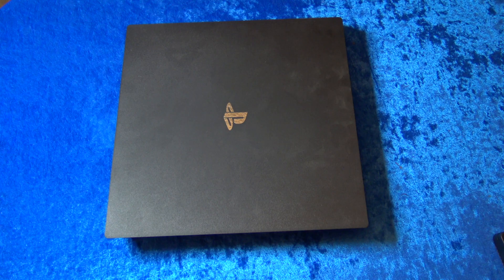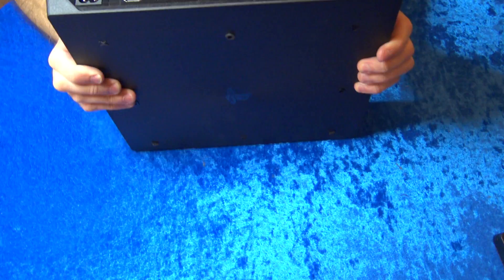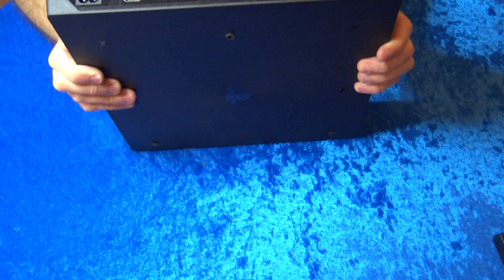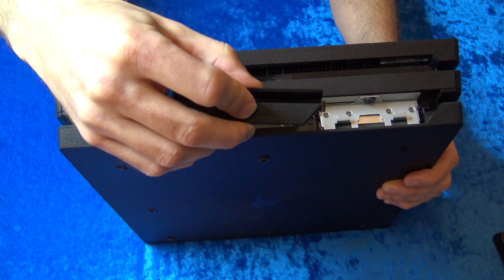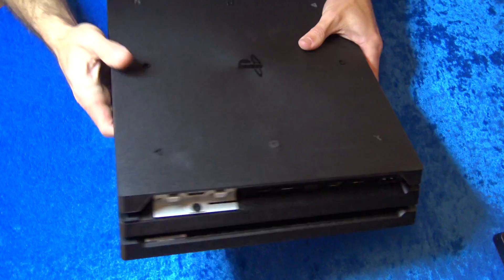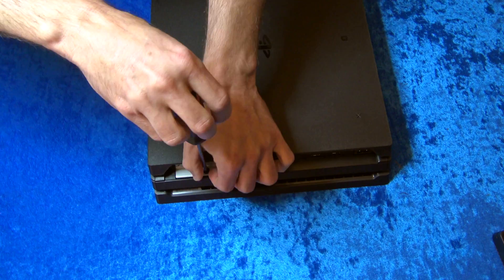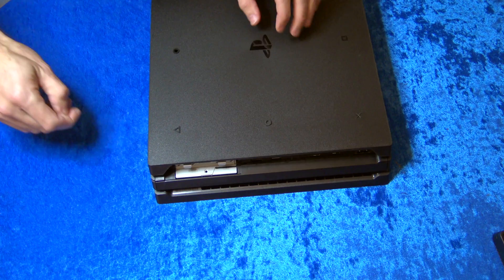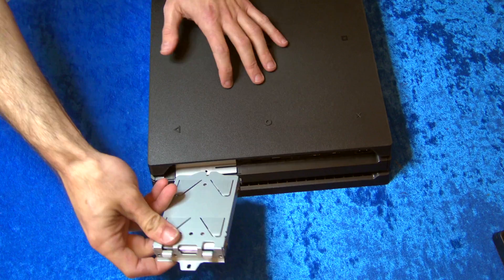To get the hard drive out of the PlayStation 4 Slim or PS4 Pro, it's located on the back side of the console. There's a small plastic door at the bottom right corner — just reach a fingernail into one side and gently pry up. If there's a lot of resistance, be very careful not to break it. With the Pro model, flip the console over to easily access the Phillips screw you need to remove. The Pro can be a little fussy to extract the drive from, but grab whatever metal you can reasonably reach and pull out. With the Slim, there's a ribbon on it to help pull it out.